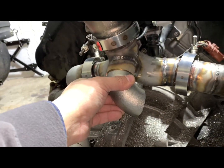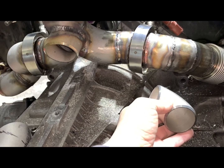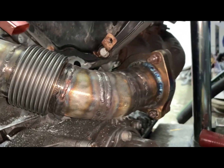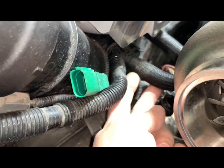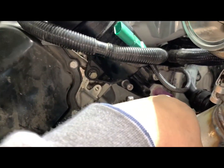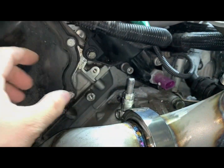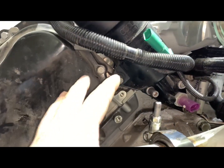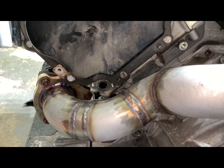Most likely I'm planning to put a 90-degree piece — maybe a four-inch-long tube — and put the wastegate somewhere around here. As far as the manifold, it's all set. When you do the fab, make sure you have the cooling line in there, you have the PCV, plenty of space for it. Then you've got to put a T for the oil supply, which I'm using here on the filter side. Wire harness is going to be here, so make sure you keep space for that as well. EGR is going to be plugged — we're not going to use EGR on this customer car.